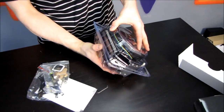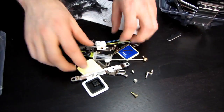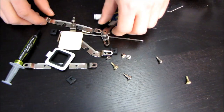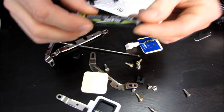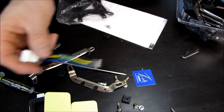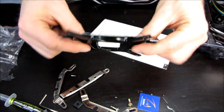I've always loved the look of Zalman heatsinks, although I've done almost nothing in terms of Zalman unboxings on my YouTube channel, so let's go through the accessories first. We'll find lots of little parts: socket compatibility including 1155, 1156, 1366, 775, AM2, AM2+, and AM3. You also get thermal grease, a sticker, some pads, a four-pin PWM fan connector adapter with an inline resistor to make your fan quieter, and a back plate to protect your motherboard from warping when you mount this cooler.